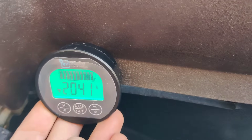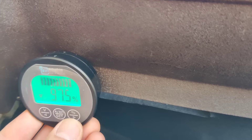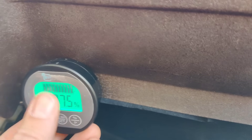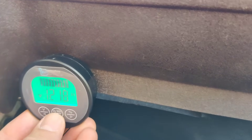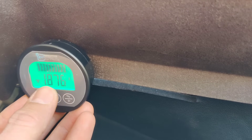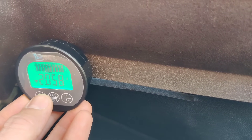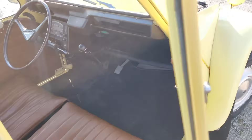From the inside, almost nothing was changed. We only added our gauge that shows the power consumed — currently two amps and 98.8 volts. It also shows remaining battery capacity and amp-hours remaining in the battery. Currently drawing two amps from the battery at about 100 volts, that's around 200 watts.